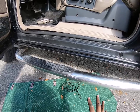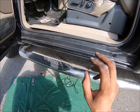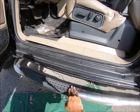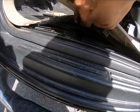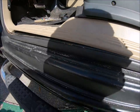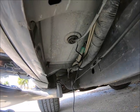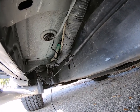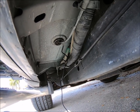Now I know what a lot of you are thinking — how am I getting this cable inside of the truck? Well, this is a little known secret, especially on older vehicles. Down here on the bottom, this is where they used to run the e-brake. It ran right up under here on the floorboard and then pops up right over there. So I'm just punching a little hole right next to it and feeding my wire all the way up so it's got a nice little safe spot.